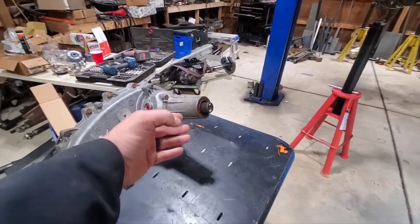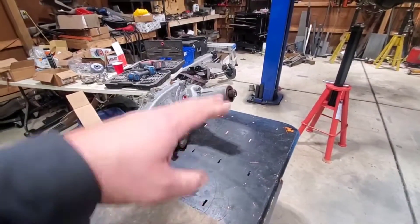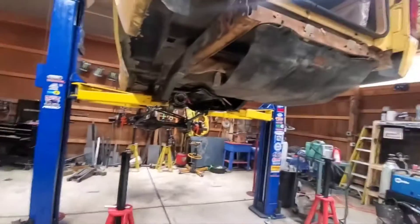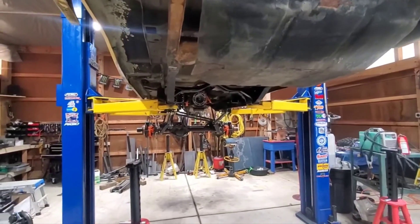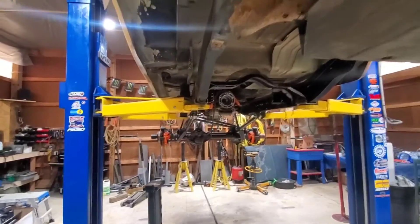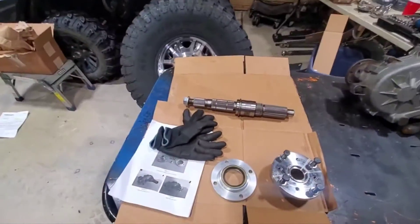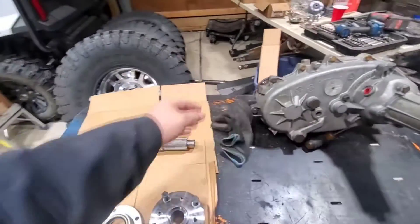Like a conventional drive shaft, the drive shaft slips in the shaft, whereas on a slip yoke the shaft slides in and out of the T-case. On a stock truck, there's not much suspension height — it's basically flat, so that's not a big deal. But in something like this, especially a 4-link setup, that's not going to be a good thing at all.